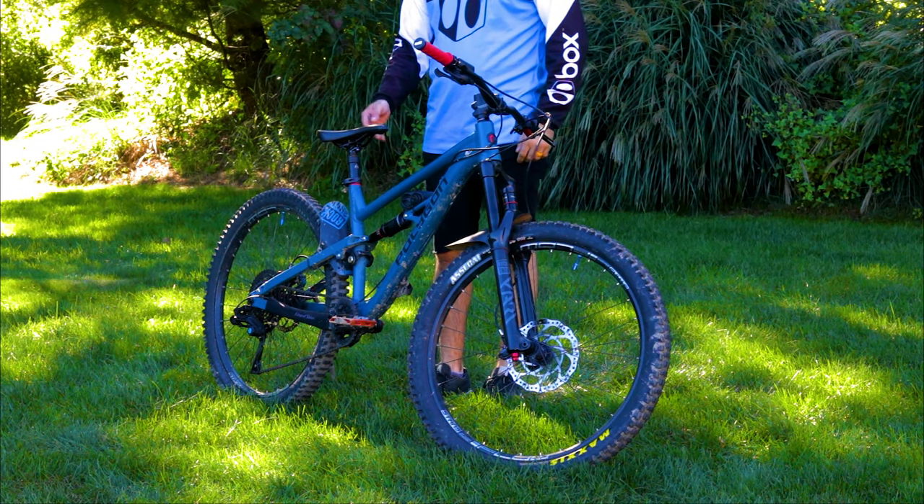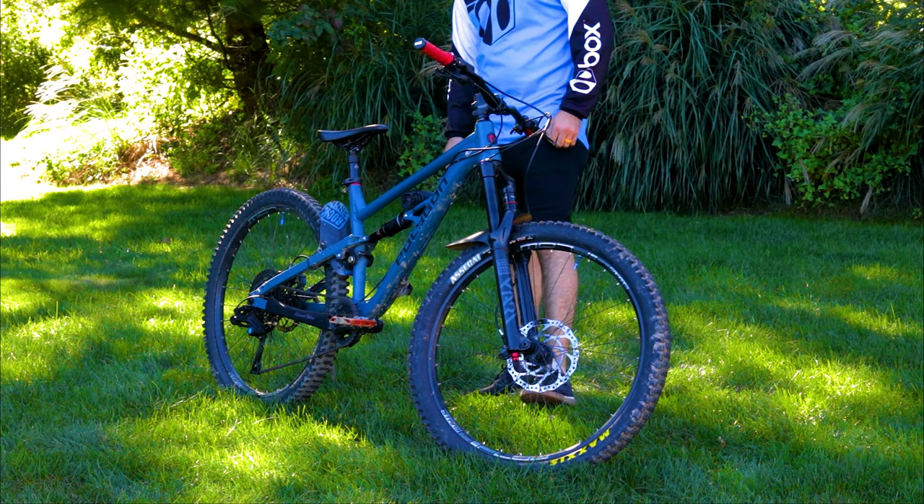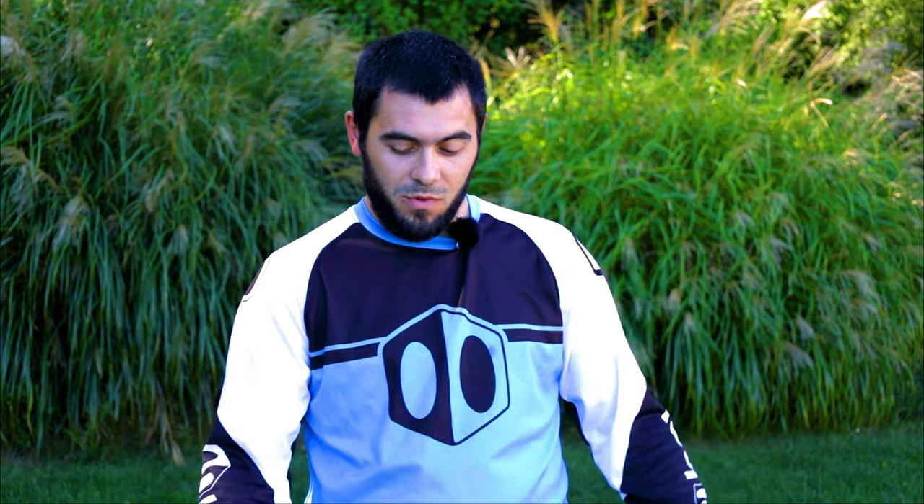The seat is the factory Entity seat — no need to change it. The dropper post is a PNW Ridge dropper post, 125 millimeters of travel. It connects up front to a PNW Loam dropper post remote, and the whole system works great. I really wish I would have gone with probably 150 millimeters of travel on the dropper post, because I feel like I could put the post itself down into the seat tube more for more clearance. I'm dropping my post all the way down to the frame when I go to the bike park for maximum clearance.